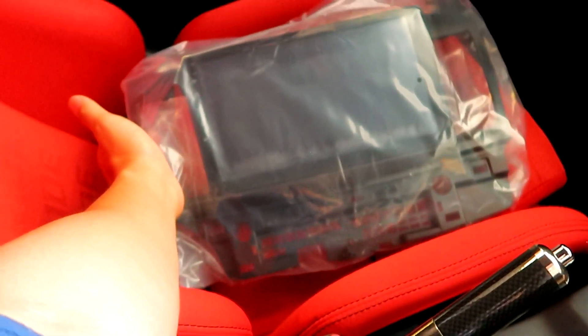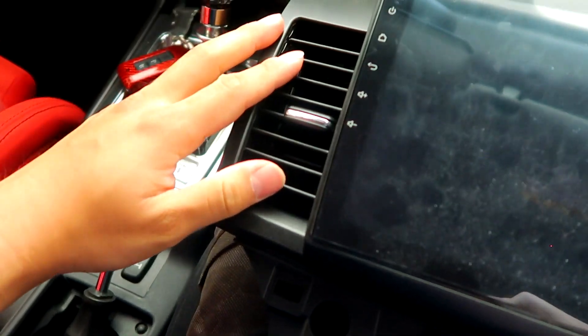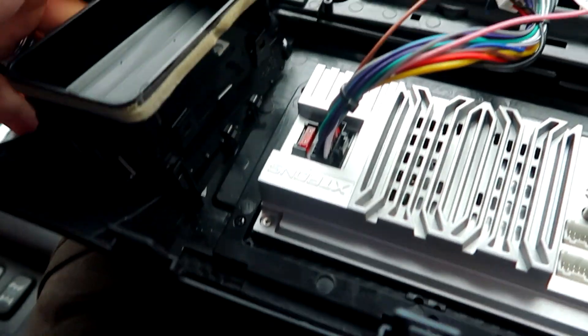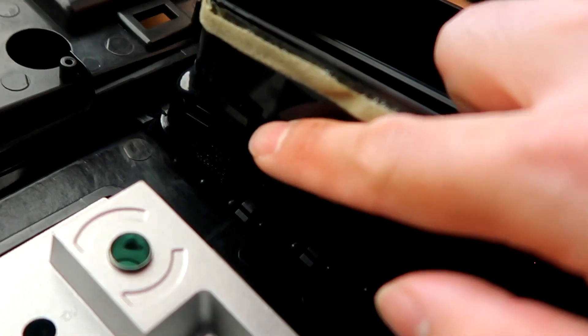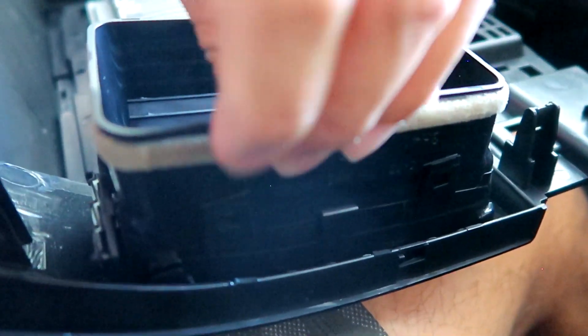We have the old one out. I'm not going to sell it — I'm actually going to keep it, probably put it in my Mitsubishi Lancer shell build. Now on the new head unit, you just have to remove the vents. Whenever you buy these head units they never come with vents, so go ahead and flip it to the back — same thing, just held on by clips. Pretty much everything is just clips or screws. You can use your fingers to pry out the tabs, or use a flat tip screwdriver if you're having trouble.